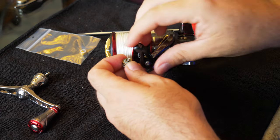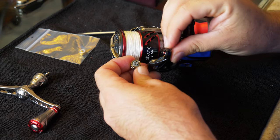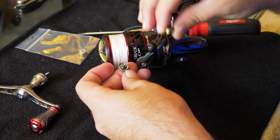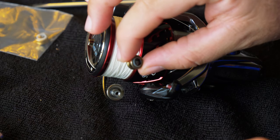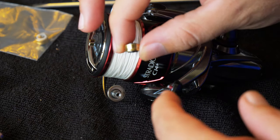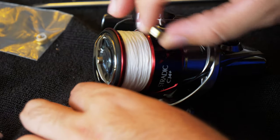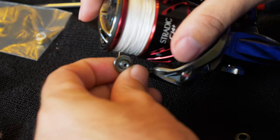There she goes - and you'll see this arm pops right up. Be careful, there are little parts in both this bearing and right underneath here that can come out. Here's the bearing that we removed - take note of how it's facing for when you put it back in. I'm going to lay this just like this, knowing that this side goes in first.